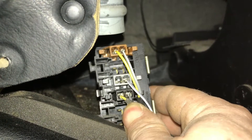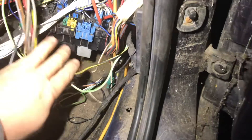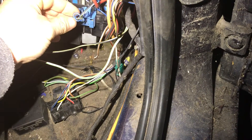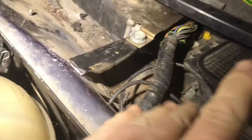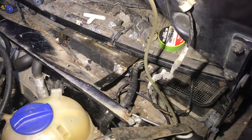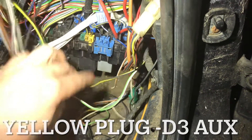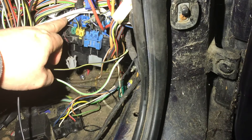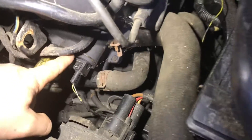Just for the VR6 — and maybe other cars — we have these two wires knotted together coming straight from the engine bay. One is blue and white with a blue plug that goes to W1. The other half of the blue and white wire goes into the ECU and tells it how fast the car is going. The other wire is yellow and black with a yellow plug going to the D connectors — it just needs to be 12 volts key-on and zero volts key-off. This yellow and black wire is going to an auxiliary temperature gauge on the manifold for water temperature.